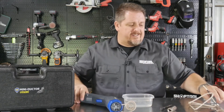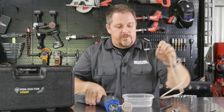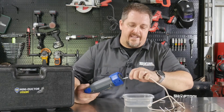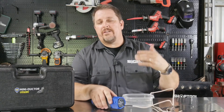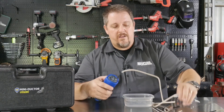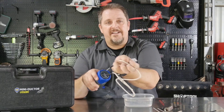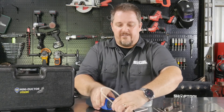This is what they call their Bearing Buddy — a more flexible stranded wire coil. What you would do is put one side in, then wrap this around — say you're working on an axle or something that may not have an actual end on it and you need to wrap around it. You wrap around it, come back, stick the other end into your gun, and now heat up a bearing race where you've actually got to expand that race to get it off that axle.